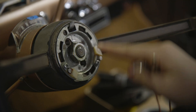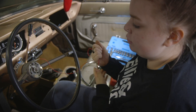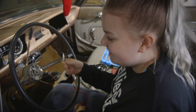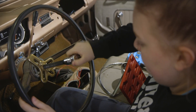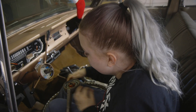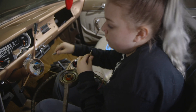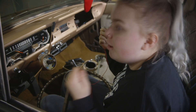So this is the ground, and these are the contacts. Normally, we're supposed to clip this here, touch it to one of the contacts, and hear the horn. It's not happening. Here are the horn contacts - they ride on these two little rings. They are working, because if I do this right, they should honk. Yeah, so they are working horns - that's not the problem.